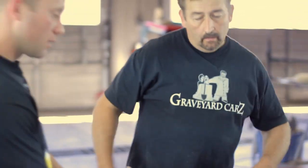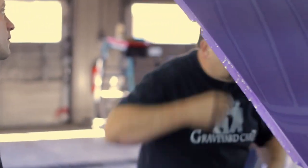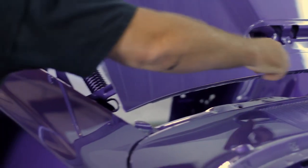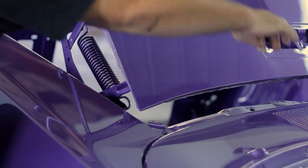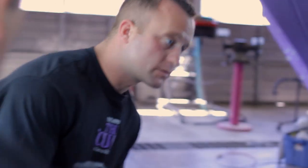The blackout is going to go all the way down and all the way across the back of the cowl. What I do is go inside — I'm very particular when it comes to painting something on a car. I take it all the way down into the reverse corner, so when we paint it, the paint gets solid right into that inside corner.